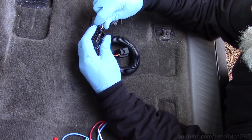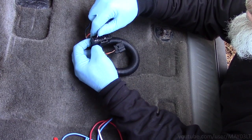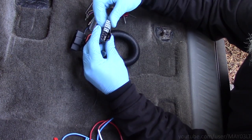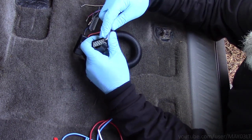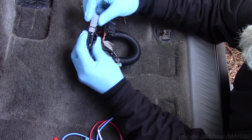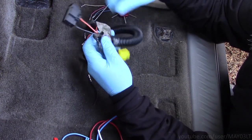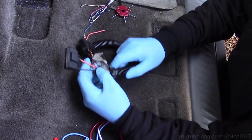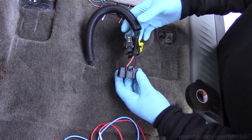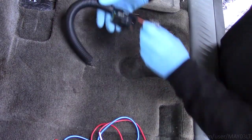Since I'm never going to wire up seat heaters in this thing, I can just pull these extra pins out. I think what I'm going to do is not disturb the other circuits — I'll just put this cap back on. I'll pretty this thing up a little bit. It's in split loom, which is what they put in from the factory. These connectors aren't going to get into any trouble, and the seat should be able to move as intended.